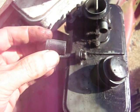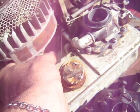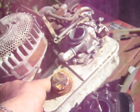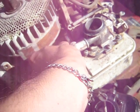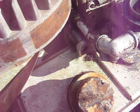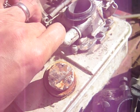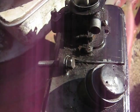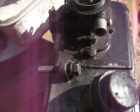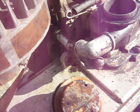Don't forget your spacer — it's very important. The spacer goes between the gas tank and the engine block, just like that right there. And if you don't have it there and you tighten this bolt down, you can crack the lug on the gas tank. I've got at least one gas tank that somebody did that on.